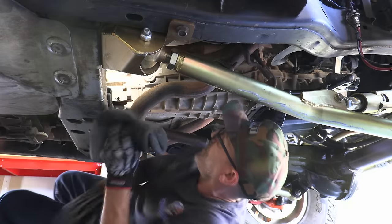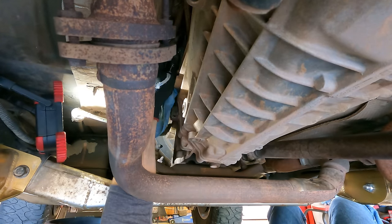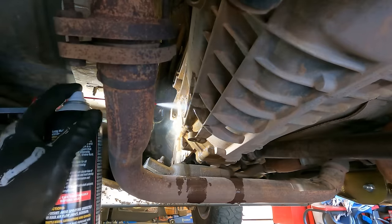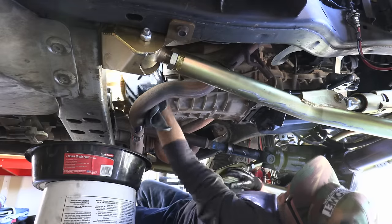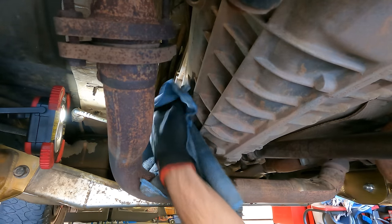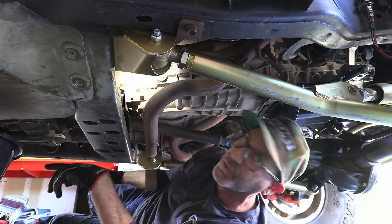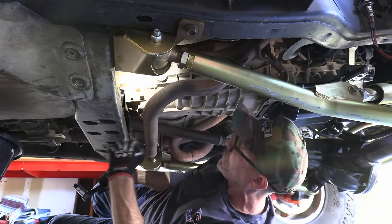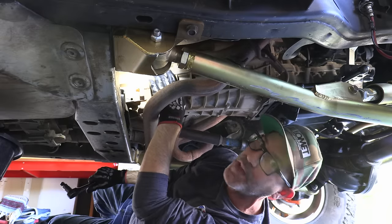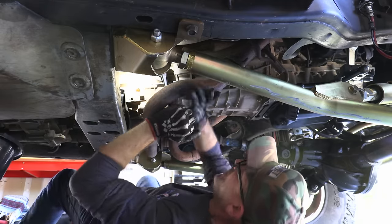It's good to knock some of the big chunks of dirt off in this area and wipe down any oil that's been dripping. Where your fill port is, you definitely want to clean that area out — you don't want to introduce any debris while you're trying to fill it fresh. This is general advice for any service like this on differentials or the transfer case: always undo the fill plug first. If something goes wrong and it's stripped, there's no point in draining it because if you can't fill it, you're incapacitated.